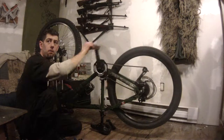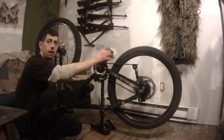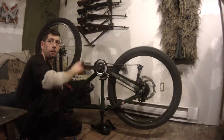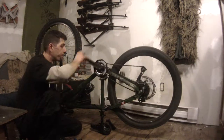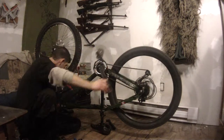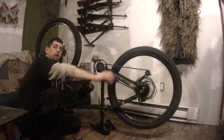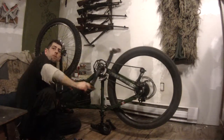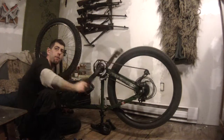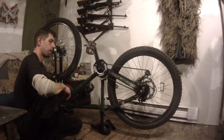A rapid fire shifter is a little slower than other gear shifting. Grip shifts are the fastest-acting gears, but I personally don't like them — I like the rapid fire, just like a trigger. I have three speeds in the front but I've taken one out and put a bash ring in its place, so it's only two speeds. I sacrificed a gear to climb logs.